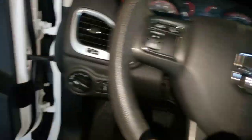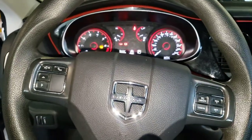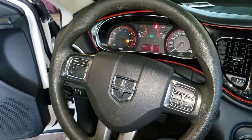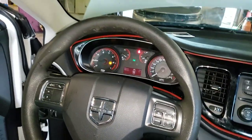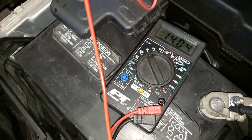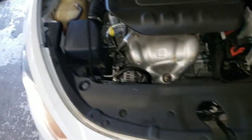You want to crank the car up, but before you crank it, turn on the ignition for a little bit, then go ahead and crank it. You can see the battery light is off. No check engine light — that's just the low tire light. Everything else is good. I'm going to check the voltage to make sure it's charging properly. That's perfect right here — 14.3, 14.2. That's right around 14, and that's good guys. Thank you for your love and support — please go ahead and subscribe to the channel. Peace out, see you next time.